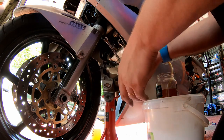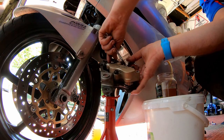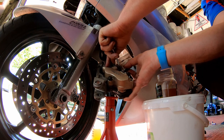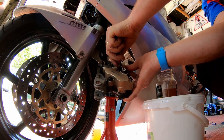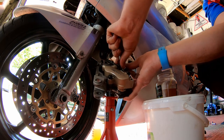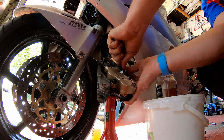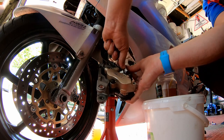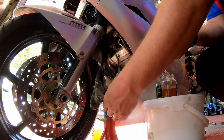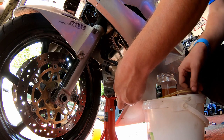Right, okay, what my assistant is gonna do now is pump the rear brake pedal 5 times and then hold it down on the 5th. Are you down? Yep. Okay, closed, let go. Down. Opening, let go, down, opening, and let go. Okay, that looks good. Right, I am fairly happy that we've got that process correct.